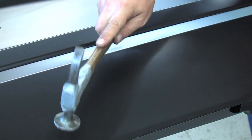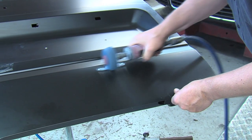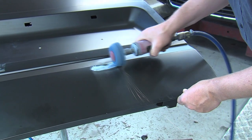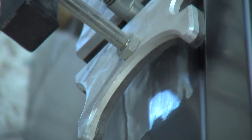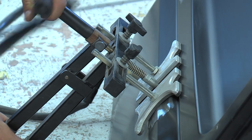Final finishing work can be done at this stage with a sliding hammer or car body hammer, still leaving the flat pad pillow inflated. Flat pad pillows can even be left inside the car body panel during welding, as they are not damaged by the heat.